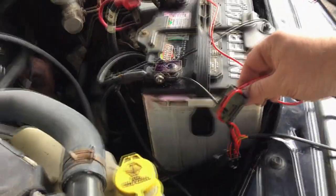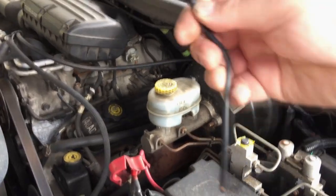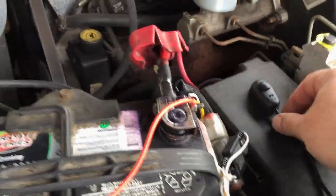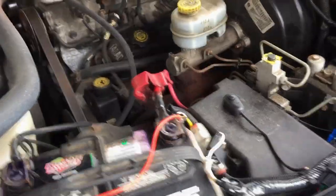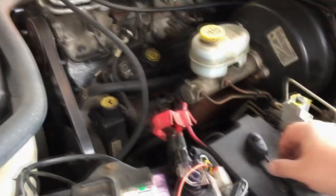You have a fuse, you have your relay right here - fuse, all real simple stuff. Then you have this harness that goes into the cab, has a plug, and on the other end of that plug is this cheap switch that comes with the aux beam kit. As you can see I already cut it off. The problem with this switch is when you shut the car off, the red light on here stays on. So no matter what you do, that red light stays on that switch. If I don't drive this truck every day - it might sit here for a month or two - I'm not gonna have this thing sitting here with this red light flaring away draining the battery. It's not cool.